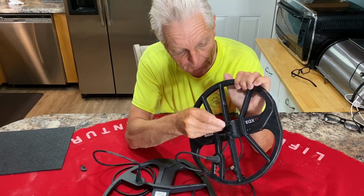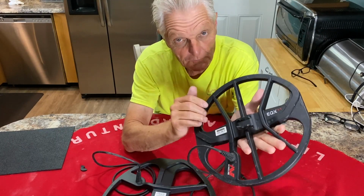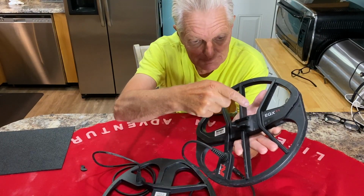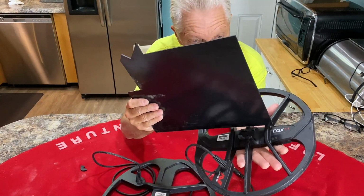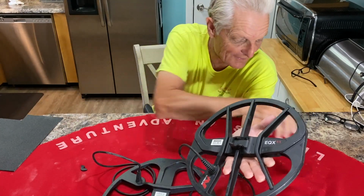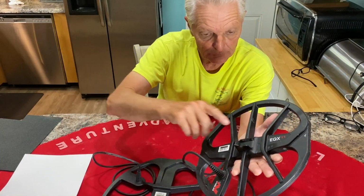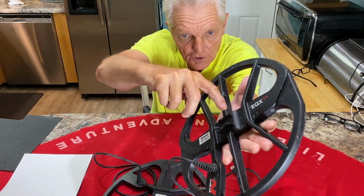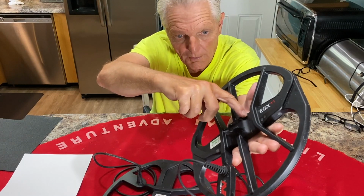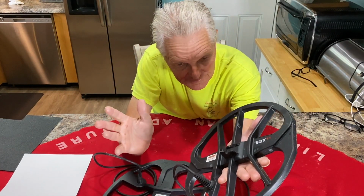This one here is the one that came off right there. But what we're going to do is put that back on, and build a backing plate behind this out of ABS plastic. It'll go behind it. But before we do that, we're going to use some cardstock to make a pattern. It'll come all the way from here across to here, which will have a whole bonding area all in here, which should fix it so it will never break again.